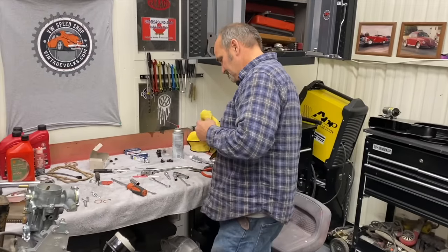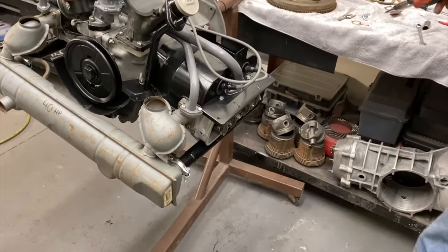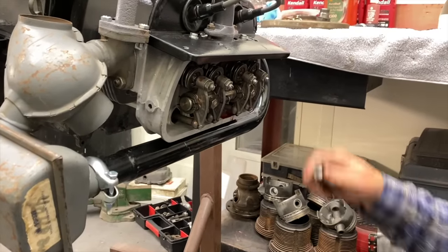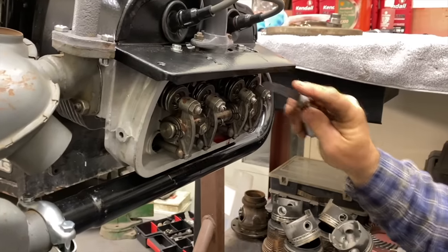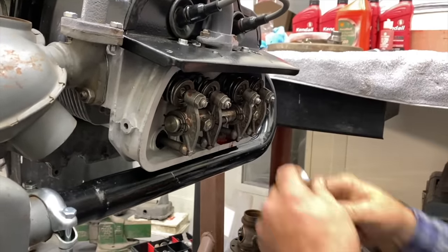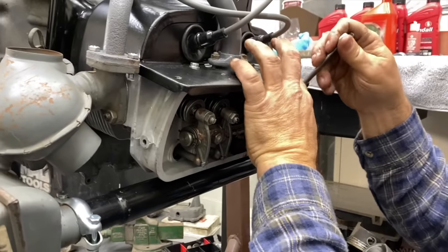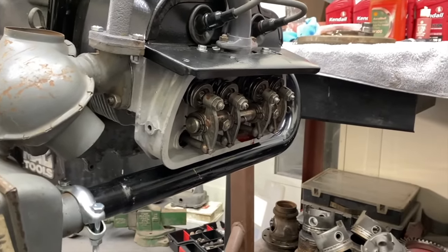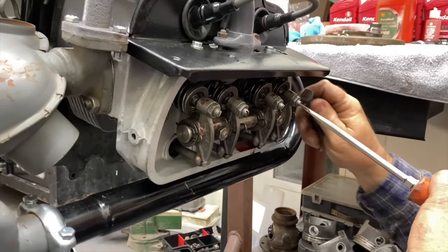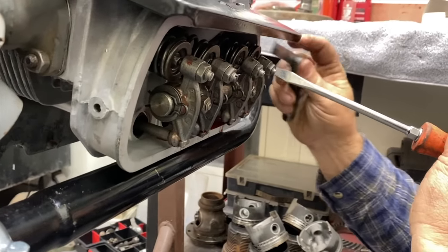Okay. You're setting them at four? Yep. And you just stay on top of the valve adjustment and you'll be fine. Okay. I set mine at zero. I would never do that on a customer car, but I can't stand valve train noise. So zero cuts the noise out? It makes it a lot quieter, yeah. But if you don't stay on top of it and one gets tight, you can burn a valve. Gotcha. I try to leave them a little bit of margin on the street cars.